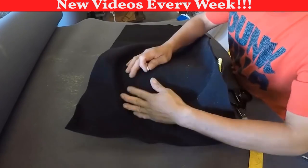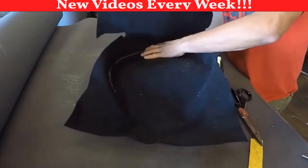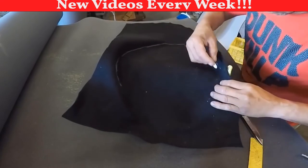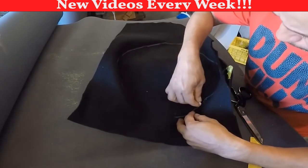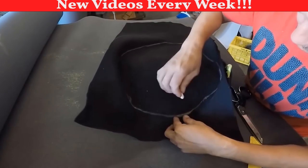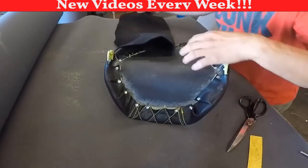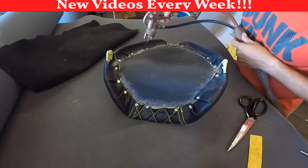Now I'm going to put this material, it is awesome working with it. This is a Tron lining material and it stretches a lot. If you are doing a motorcycle seat cover, I recommend you put this kind of material because first it is flexible, it is not like carpet. And it looks nice. You might say, well, you just said it doesn't show. Yeah, it doesn't show, but when the customer comes and takes the motorcycle seat from your office, he will see it from the top, then he will twist it, and he will see it from the bottom.